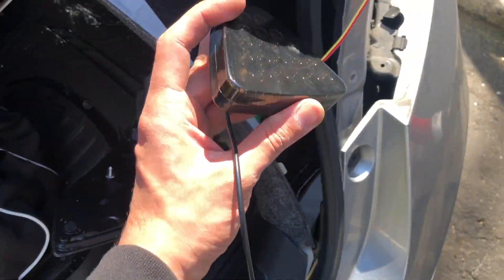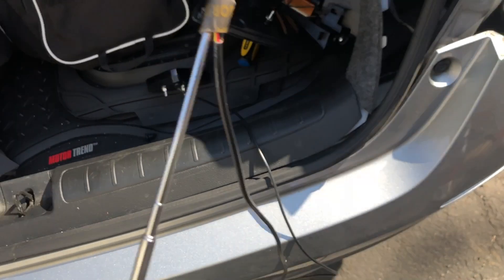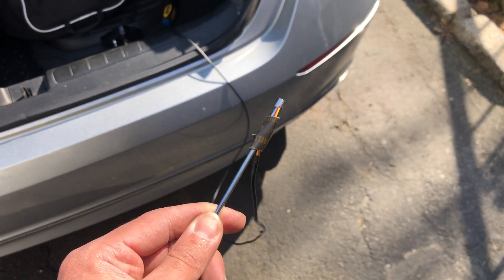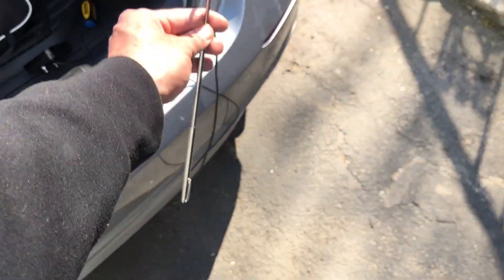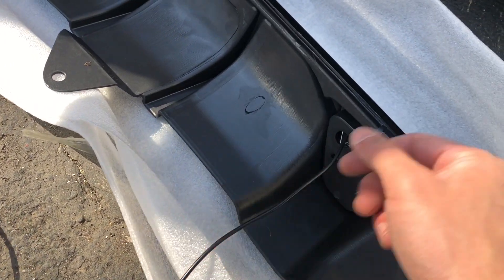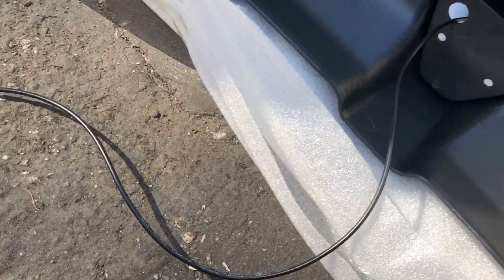Put the tail light to the side and we'll just work on this. You can see there's this base down there — right there by my foot. From there, I attach the wires with this magnetic extending tool. You can also break a hanger, cut it into a piece, and make it extended. Just pull it from the bottom up and someone grabs it from here and you're good to go. The wiring goes through here first, then take these bolts off, put it in, screw it, then do that trick I showed you — and you're good to go.